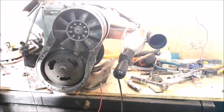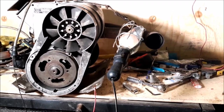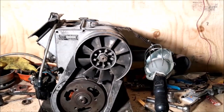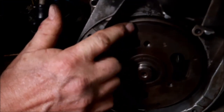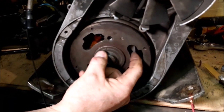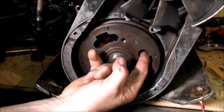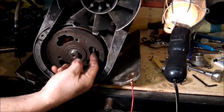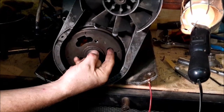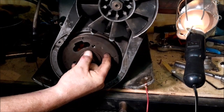So I need to show you how that works. I'm going to get this camera right up close for you folks. I'm going to shut this light off, or at least turn it down, so you can see what's going on. So this line here — when it meets up with here — that light should dim. Keep an eye on this line now. I'm going to advance this fully. As soon as that line hits up there, it should dim. Yeah, it did! So that's how you set that. This advance here has to be all the way advanced — you've got to push that open with your fingers. So see that line lining up there? Bang — that light dims.